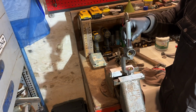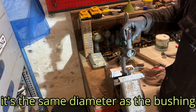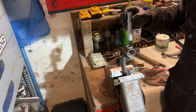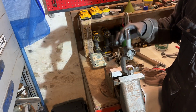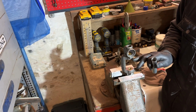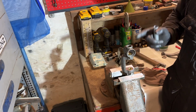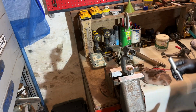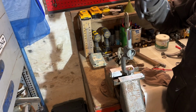Sometimes you will have a little bit of play here on top when you push that in, but it's only one size you need to take care of that. So you see, if the second bushing is in, you cannot use this. So just start with the upper one or the lower one with the tooth that you have to cut out, and then you can use this tool, turn it upside down like now, but then this tool is not needed anymore. But if you use that at first, you know it will be centered.